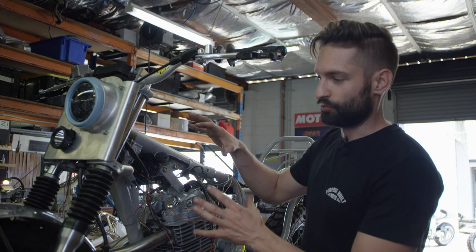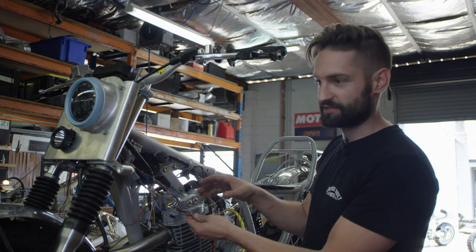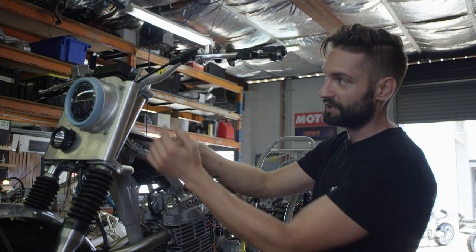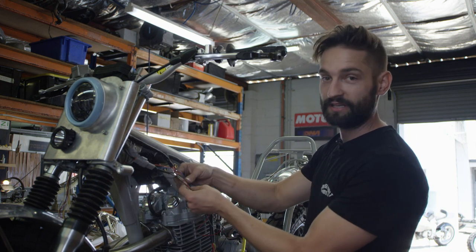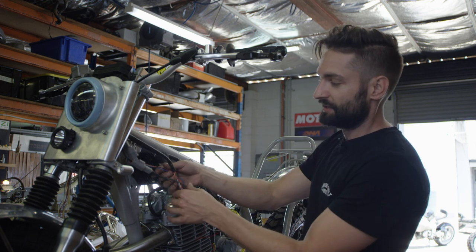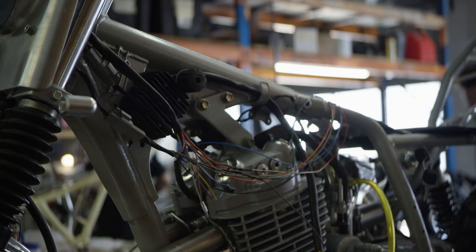When wiring these bikes, I'll tend to take two looms up to the front from the electronics under the seat — keeping them separate with my button controls and then my lights and accessories. I'm looming up my lights and accessories running from my black box under the seat up to a couple of Deutsch plugs — waterproof plugs — one for my indicators, one for my headlight. This wiring goes up to the speedo, which has a digital dash with all the warning lights. I'm linking those up with a solder connection I can trust, and the only other connection will be to my black box strip terminal.